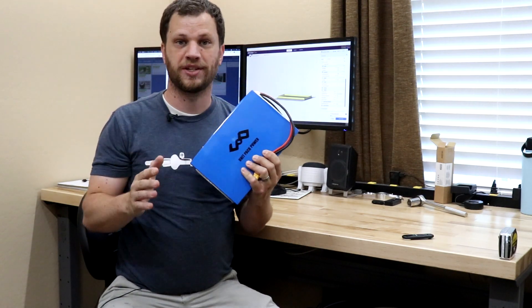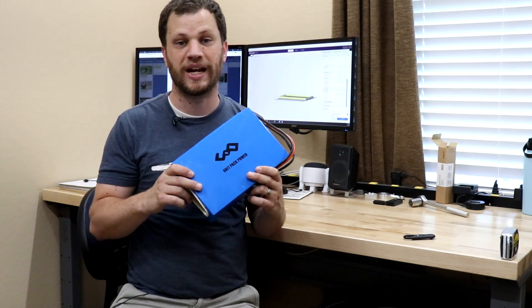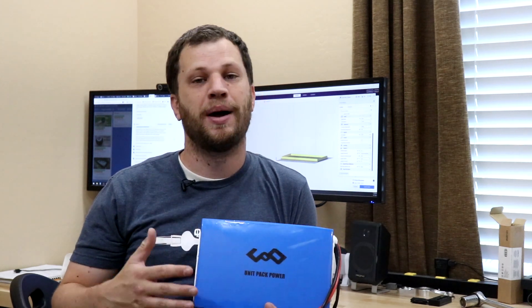Here's the battery I'm going to be using for this project. It's a 48 volt, 20 amp hour battery, which means it has nearly one kilowatt hour of energy stored in it. This capacity should translate to a very far range for this board. There is a major drawback however — it's pushing the design to be a little bigger and bulkier than I originally hoped for, but that's a trade-off I'm willing to make.